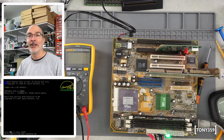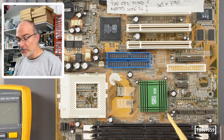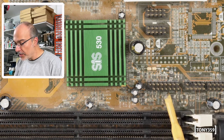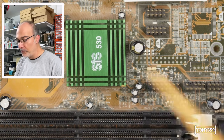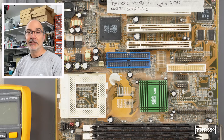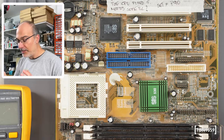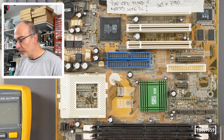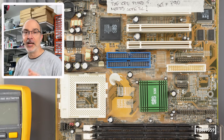Actually, I didn't realize that this chipset has an integrated VGA on the AGP connector. Here is the VGA connector. So when the BIOS said AGP, it was posting through the internal VGA — if I'd plugged a VGA adapter here we would have had video output through the integrated VGA. Amazing! I think I only have one other motherboard with integrated VGA, which was not very common back then. So I'm assuming that's totally fine and that's why AGP is an option in the BIOS.